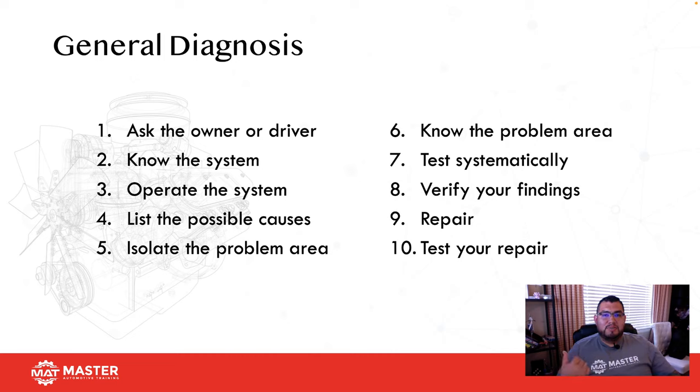It's not the customer's fault that you don't know how to charge, and it's not the customer's fault that you are not properly doing what you should, which is verifying the actual repair. So you rerun the same test you did to find the concern, and that's how you're going to verify if your repair was done successfully. Don't let the customer do it. That's why they come back pretty pissed off.